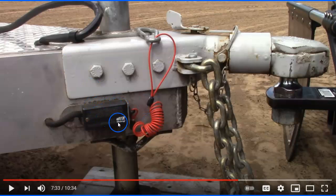He goes over the breakaway safety system — you need a battery in your trailer and connect this cable to it. If your trailer fails: first backup is your chains, second backup is the emergency braking system if you have electric brakes — but you need a battery to activate it. I honestly don't hook mine up because I can never keep a battery charged in there. In some states you might get a ticket for not having it. You really should do it, but keeping a battery charged in your horse trailer is its own challenge.